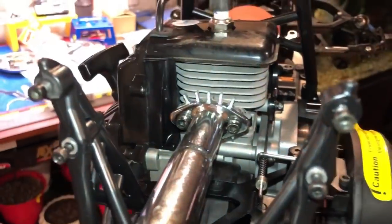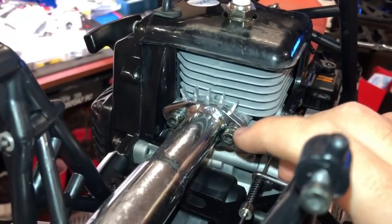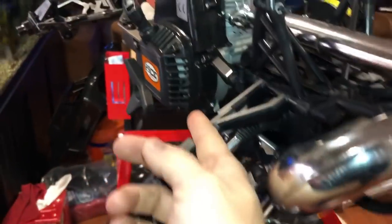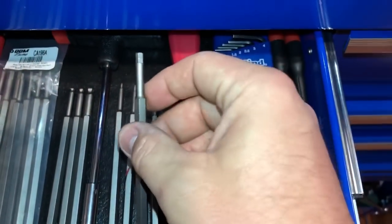One thing I want to bring up real quick. Very simple thing. Every time I get to something, sometimes memories start appearing. One of the memories is that I have known a lot of people who would screw up their exhaust bolts and break the tips on their tools. When you go to break off bolts, like an engine bolt or something that could be stuck, do not use those Allen tools. You have a high risk of breaking these ball ends or even stripping out your hex ends.